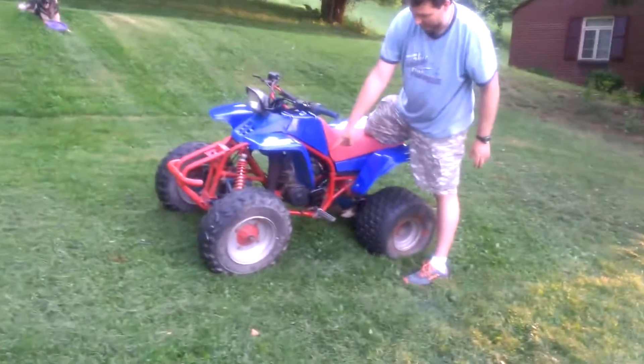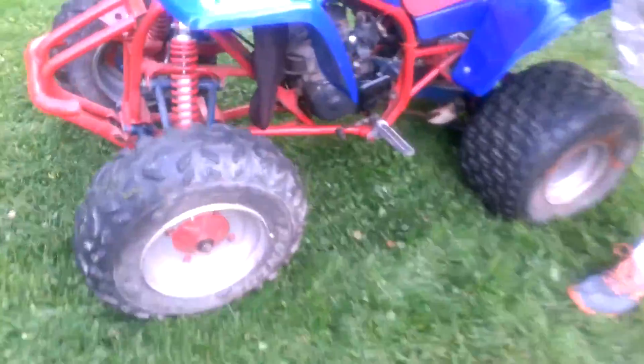You can look right here — trying to get a close-up of where the VIN number is. It looks like it's been painted a couple of times, that frame. It's not filed or scratched off. I think if I put some paint remover on there we can get the VIN number to get the year off. They say the 10th digit on the VIN number supposedly identifies the year.